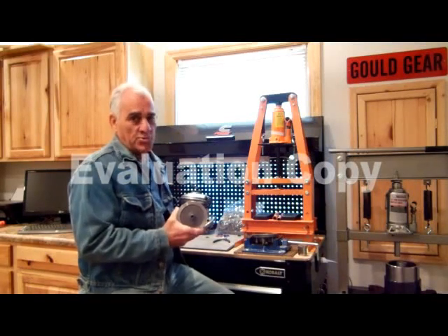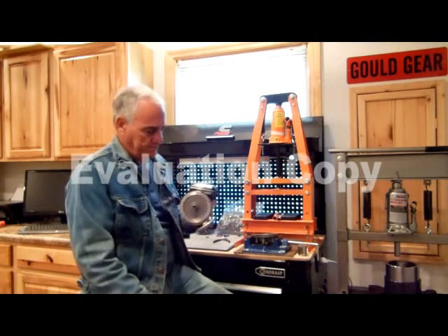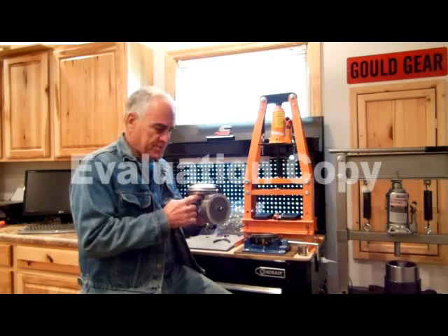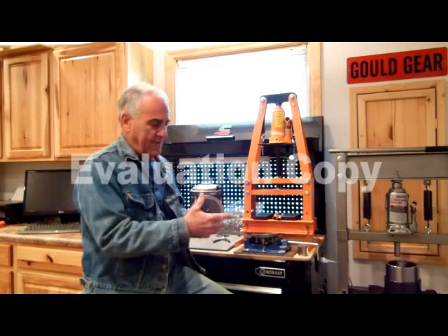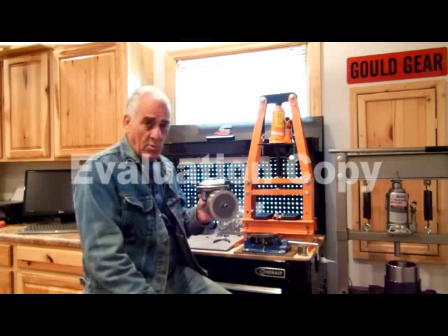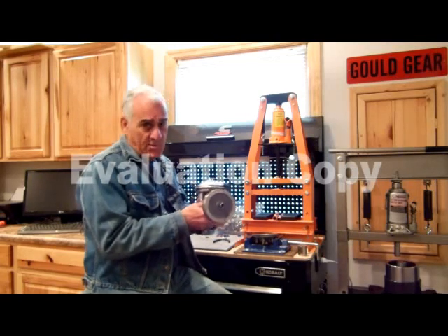Hi, I'm Pete Gould at Gould Gear and Electric in Murphy, North Carolina. Today we're going to talk about your Dodge Diesel exhaust brake option and the vacuum pump itself. We're going to do a little bit on the diaphragm, which is what goes bad and starts making a racket under the hood, kind of going tuk tuk tuk tuk tuk — and you're happy to find out it wasn't a rod knock, that's just a diaphragm making a racket. I'm going to take one apart, show you what's inside, how it works, how we fix them, and how to replace it.